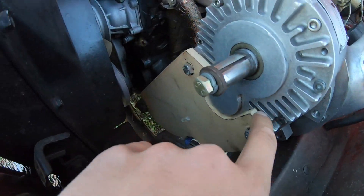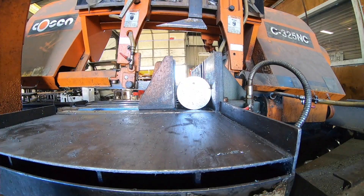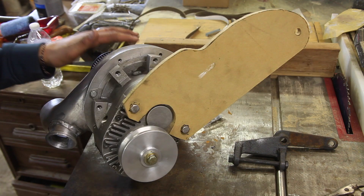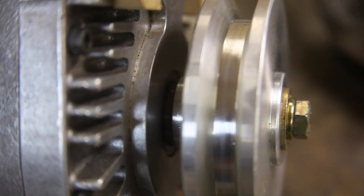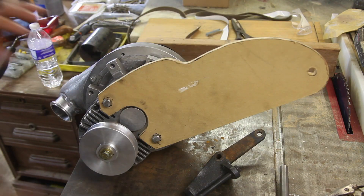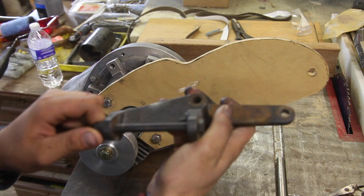I did make a new mount out of MDF just to make sure when I make one out of steel it'll fit up perfectly. On the way back from the metal store we stopped by my friend's dad's metal shop, Kenny's Pulling Parts. We gave him that block of aluminum and he put it onto one of his CNC machines and made us this 7/8 inch drive v-belt pulley — it's a 4 inch pulley, so it should work great with our 6 inch pulley on the crank. Now that we have a way to drive this supercharger, I'm going to trace the MDF piece on steel, cut it out with a plasma cutter, and weld it onto a steel tube to mount on the old smog pump mount.